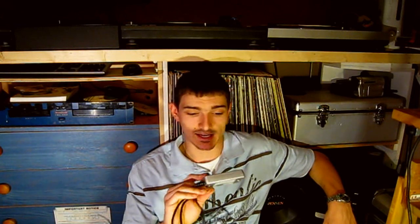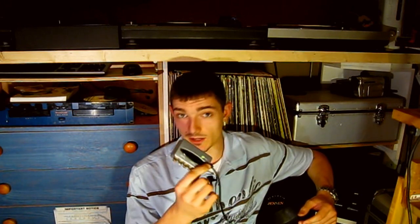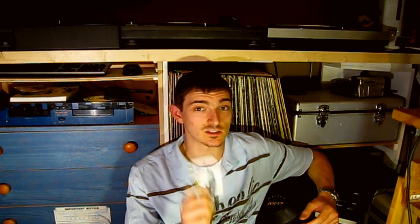You want to get yourself a couple of these — I'm saying to get these because you can get them for about 20 quid. It's a Behringer UCA202. I've had this one for about two or three years and the newer ones actually have a Toslink connection and an extra headphones output as well, but they're about the same price. These things are really good — all you need to do is plug it into a USB port and when the green light comes on, you've got audio. It doesn't even come with drivers. It works with Windows XP, Vista, Windows 7, Mac, Linux, everything — completely plug and play. You've got an audio input and an audio output on there. Two of these will probably set you back about 40 quid.